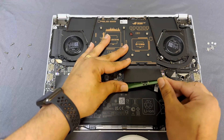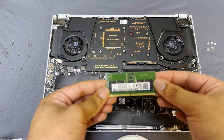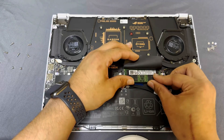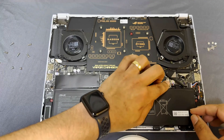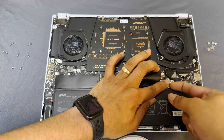To remove the RAM, just lift up the black film sitting on top of it, and push the two clips on either side of the PCB outwards until the RAM springs up. Next, you'll grab your new module, make sure the notch on the inside of the connector is lined up with the notch on the PCB, then slide it in and push it down until you get a click on both sides. Reconnect the battery to the logic board, then slide the metal clip back towards the connector.